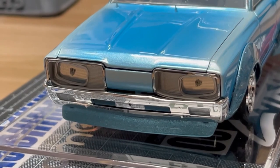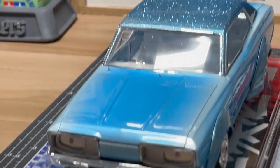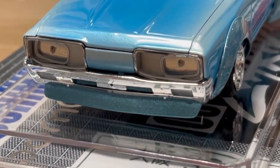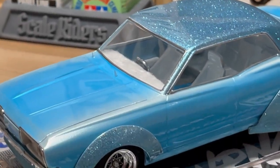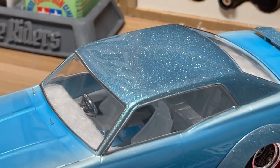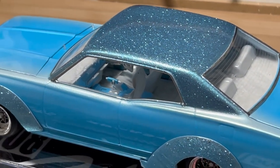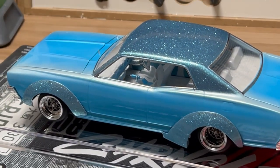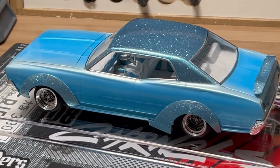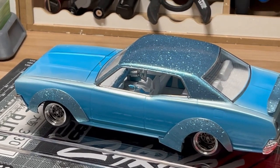As far as the wide body fenders, the wing in the back, and also the front lip — those are all items that I ended up flaking. I ended up using the Tropical Glitz Flake Platinum Plus, and that was a flake that's the size of .004, the ultra fine. The type of paint I used on this build was a House of Color paint — pretty much pearls, candies, and along with the metal flake here.